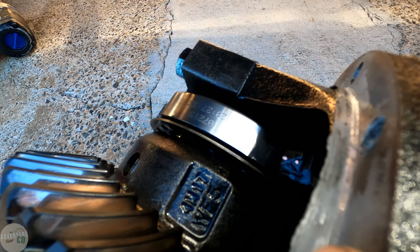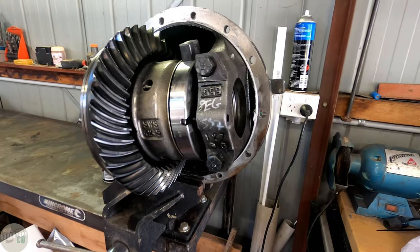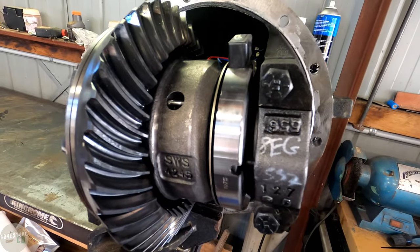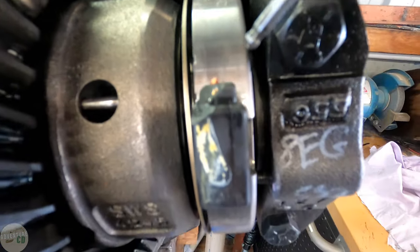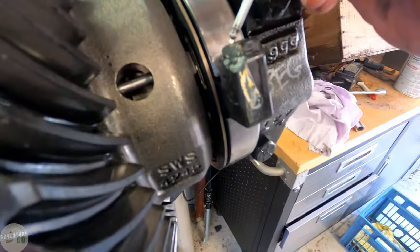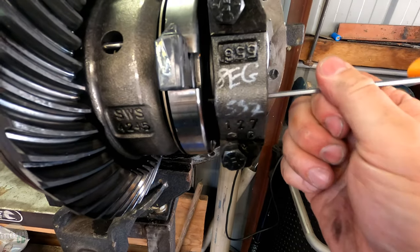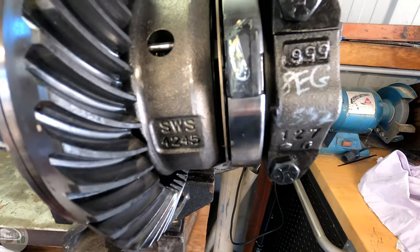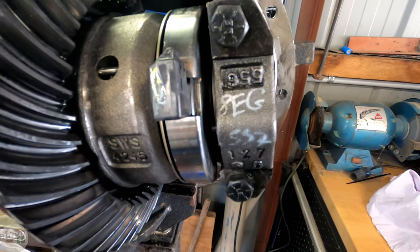Well, it's all explained. I've put the diff centre up in my vise - just an easy way to hold it. I'm thinking about trying to fix it myself. The actual diff is okay, it's just this locking mechanism. It's really just about connecting these two broken wires back to the connector here. If I can join them, I've done pretty well and I'll save myself a packet of money. This little grub screw here is just entirely free - no resistance whatsoever. Whatever's meant to lock it, whether it be Loctite or a lock nut, I'm not sure. I'll put some Loctite in there and a lock nut as well so it can't move again in the future. For me, this is a Ford problem, not mine.